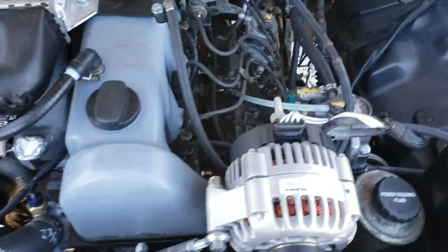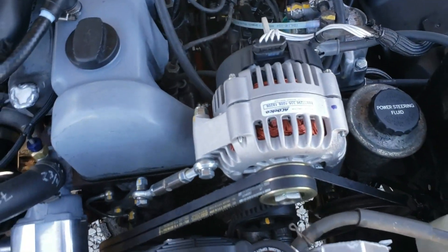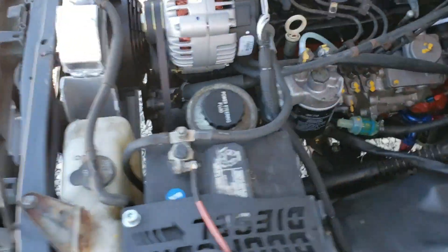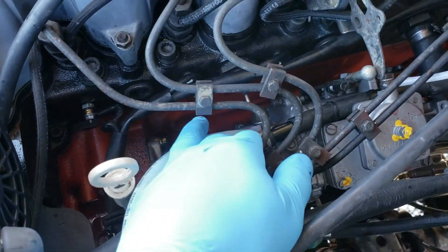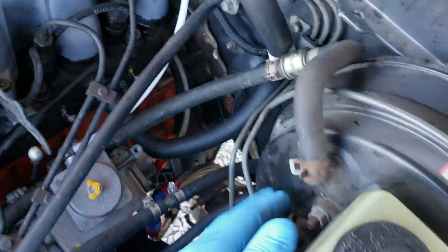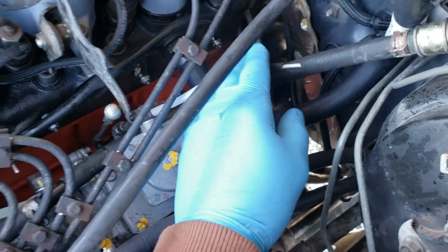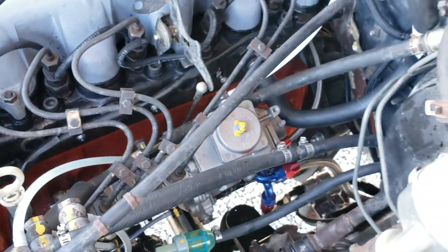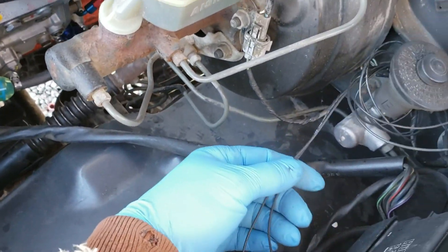As for the vacuum, it's not completed yet — we're waiting for a vacuum solenoid to arrive. The vacuum line comes through here, snakes underneath, and I've got a splitter. Vacuum comes up to your brake booster and then there's a line for the shutoff solenoid, and these wires here power that solenoid.